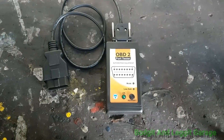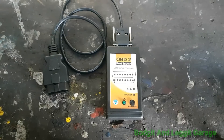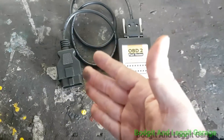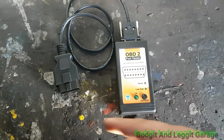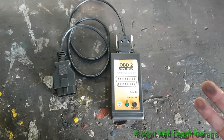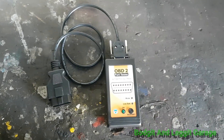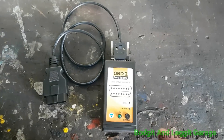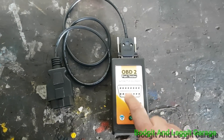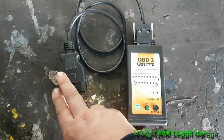The beauty with this little box is it tests your OBD2 plug. For example, I had a car come in recently — it came in through another garage as a trading car and I didn't know the state of the plug, didn't know if someone had messed with it. A lot of people are messing with their OBD2 plugs now because that's how a lot of cars are being stolen. They use fake plugs, and if you plug your scan tool in and they've wired it up differently, it could blow up your scan tool. If you've got any problems with the lines or any of the pins, this will actually tell you and lead your diagnosis quicker and easier.